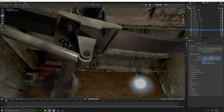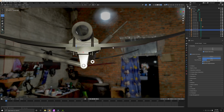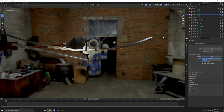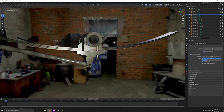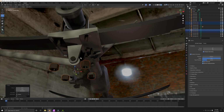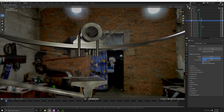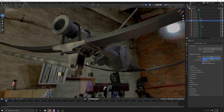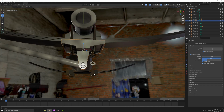Those guys right there. So then, of course, you want to put a jack under this leaf. The reason why is all this right here, when it's up against your chassis, is loaded. So when these guys come all the way off, you need to put a jack underneath that, put some tension on it, so when these guys come off, it doesn't unload and throw all this stuff down really fast on you. You don't want that. It almost hurt me when I first did that because I wasn't sure how it was back in the day. So don't do what I did.